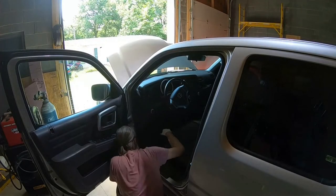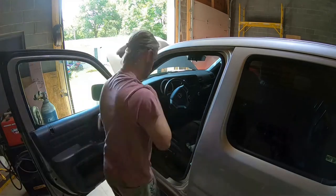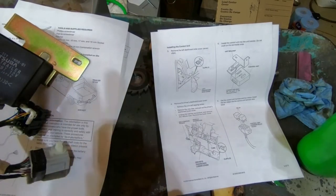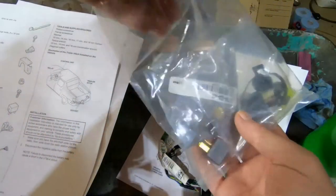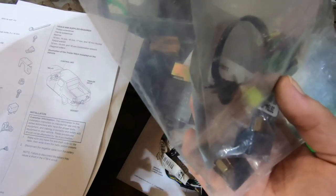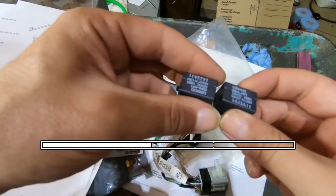Just don't be lazy — disconnect your battery. This is definitely a big change in the electrical system. The dash popped out pretty easily; I just gave it a good pull and each tab pulled out without breaking a single thing. Here I'm just verifying where those relays go. The directions were a little weird, and my kit came mostly pre-assembled, but I think I ended up putting one component in backwards. That's the relay I bought, so I was just making sure it was the same.